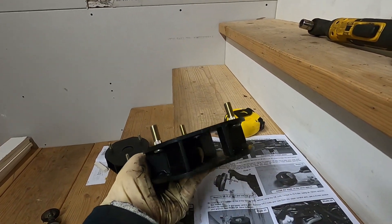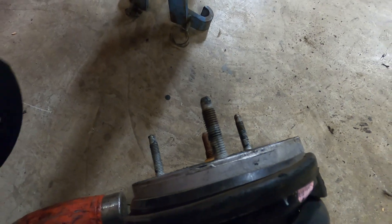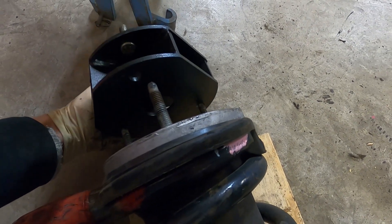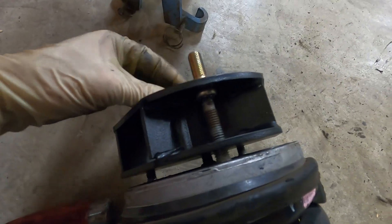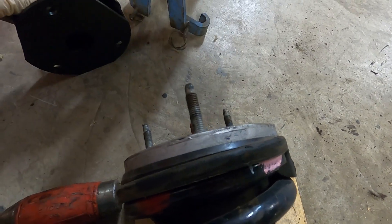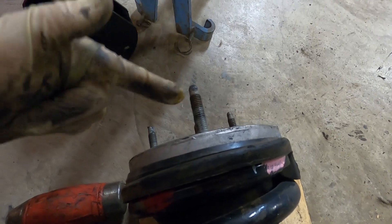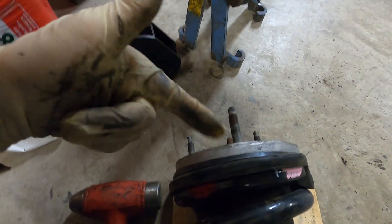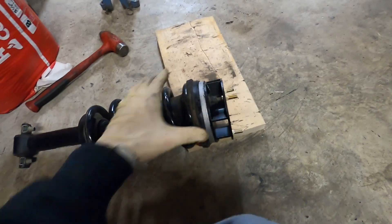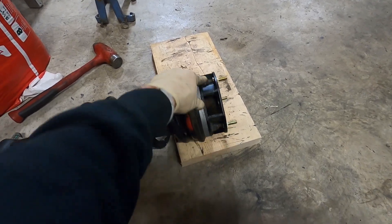That's what it looks like when it's done - studs pulled through into the knurls. Now we need to trim off some of the stud that sticks out of the top of that strut assembly, because as you can see it's not going to sit flush. These only go on one way. You're measuring three-eighths of an inch from the top of the stud down and cutting that off with a cutoff wheel - that'll allow room to get that assembly together. With those installed, we're going to put the spacer on top of the strut, use the factory mounting hardware, and tighten it all up.